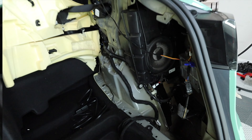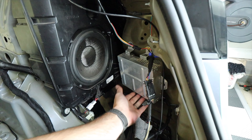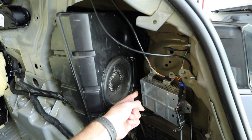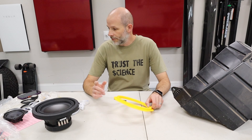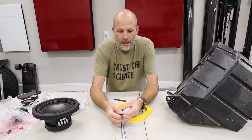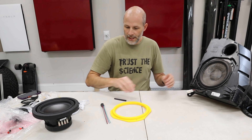So I'm going to put the panels back together, put everything ready to go for the sub. Now to remove the subwoofer, you do need to remove quite a bit of stuff — you need to remove the amp. There are three bolts on there — one here, here, and underneath — and you just remove the wiring. This is the only connection to the speaker, you just unplug that. There's a bolt here, a bolt behind there, and one right here, and then this can come out. So now it's time for the subwoofer. We have a connection that matches the connector on the stock one — it's four wires and they need to be black, red, blue, and green in that order. You want to double check that.